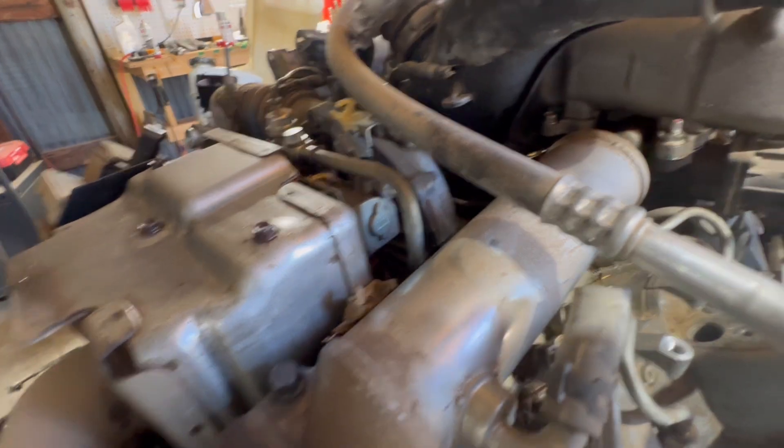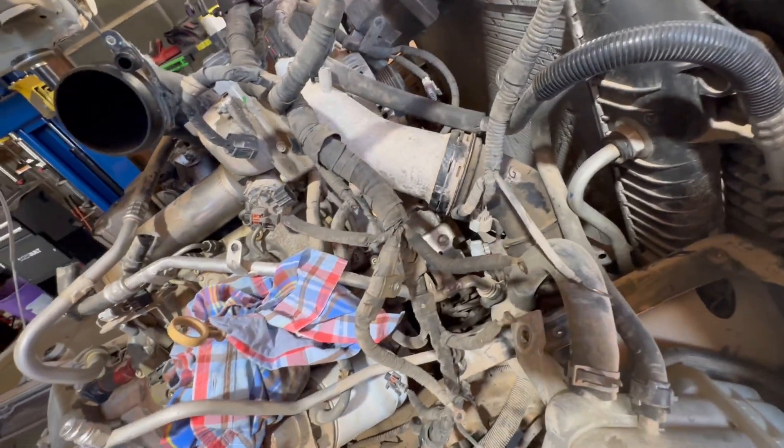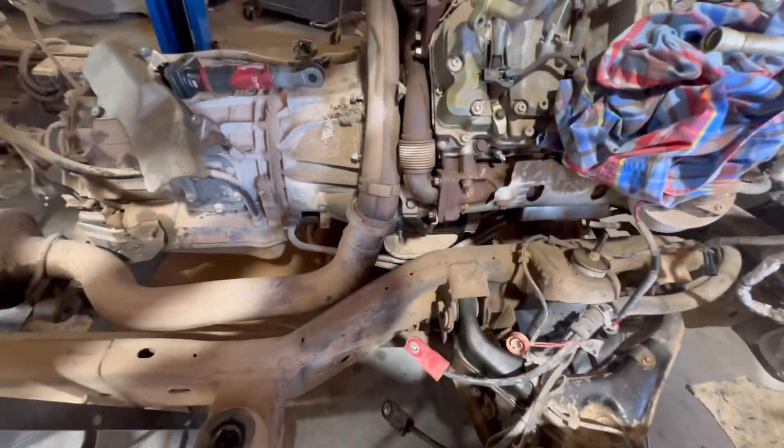Just put a bleeder valve — a little valve stem screw — and bleed it out. Simple enough. That'll be replaced. We're going to replace parts and the harness at the same time, so we're getting all of this cleared so you can see what you're working with wiring-wise. This truck will get a new AC compressor — it's shot — new alternator, and possibly a new starter. We'll test voltage and see. Also drain oil, drain trans fluid, put new trans cooler lines on.